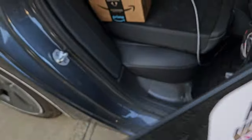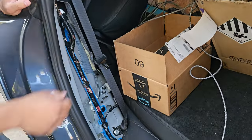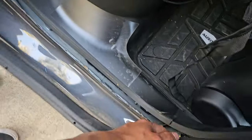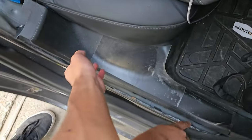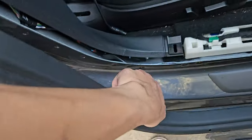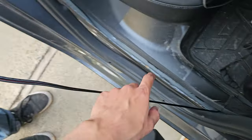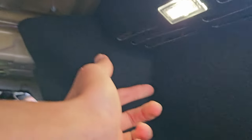Wire pass-through done — a lot of work. Now we're going to route it along here, but we need to take out this panel and the back panels. Just pull it out and lay it over. We need to take the weather stripping out first — it just sits on a track and pulls out. We should be able to pass the wire right through this little channel here, so let's try that. It worked! We just pass the wire through here and a helper grabs it and pulls it through. Now it routes to the back — you might need some fishing wire to get it there.